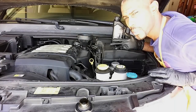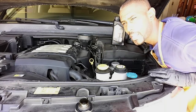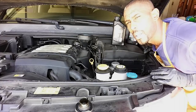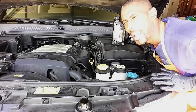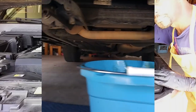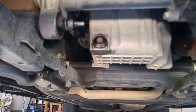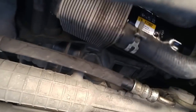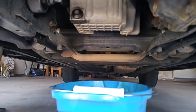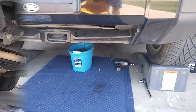I just poured the seven quarts in, so I'll go ahead and check it right now. Then I'll get underneath and see if there are any leaks. I'll start it up and check. Right now I have the engine running and I'm checking to see that there are no leaks from the drain plug, and no leaks coming from the oil filter. I'm good. I'm going to turn it off, put the skid plates back on, take it off the ramps, and then top it off.